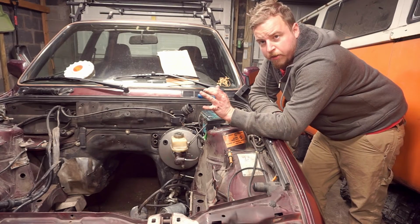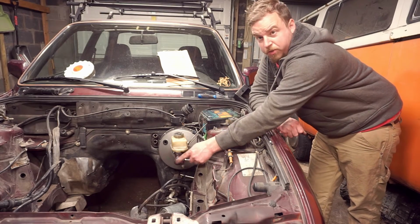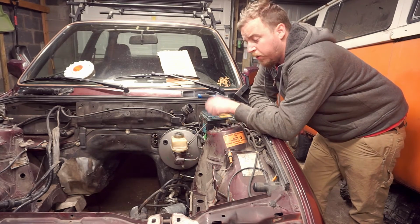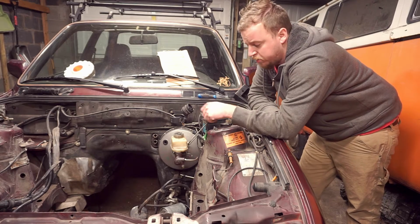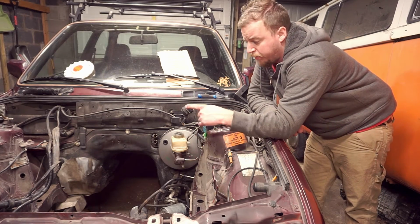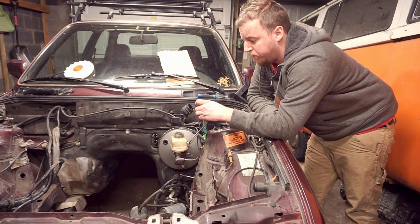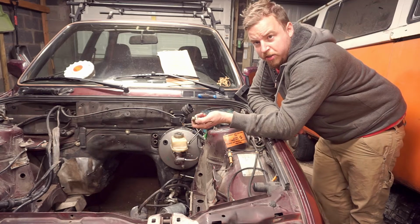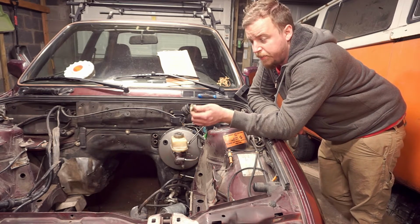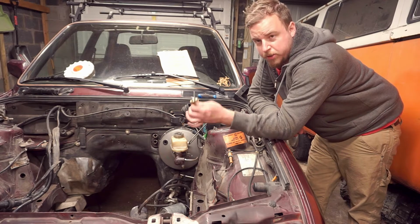Alright, now that we have our rear brakes finished up and plumbed into the master cylinder, which is actually the front portion for your rears, we're going to finish up the front brakes. All that's really left is to bend the driver's side up, and we're going to use this pre-existing line from the passenger side. We're going to cut it down and flare it. But we bought this handy dandy T-fitting. This is actually a BMW part, costs about $25, but we know it's going to work.